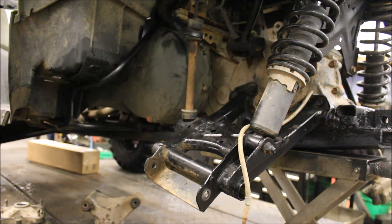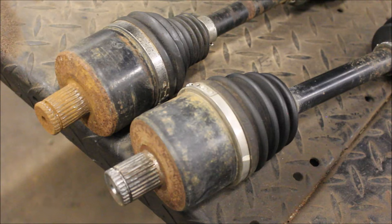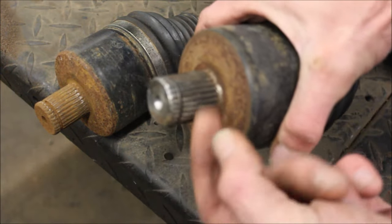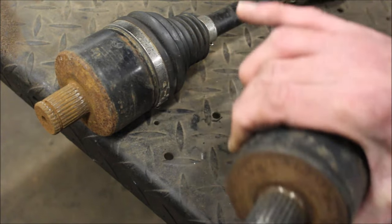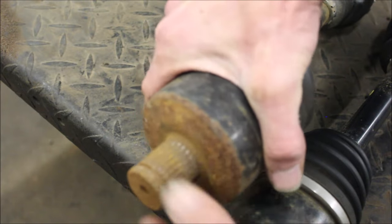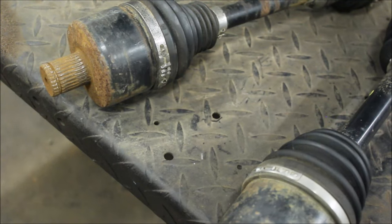And I ordered a new axle shaft, and I'm gonna show you the difference between the two in about a minute here. All right, well, I hope that's focusing in for you guys. So these splines are really good. Got some good grooves. This is a used one that came off of a 2007. This one, they're completely rounded off. So that's where I got lucky, and I've never come across this.